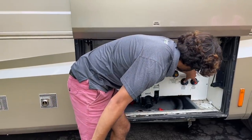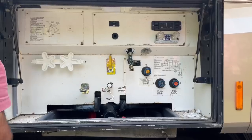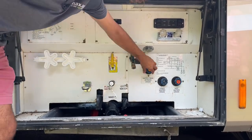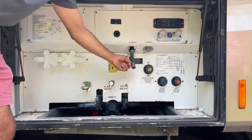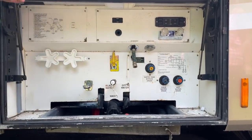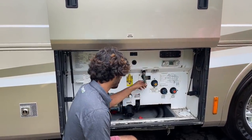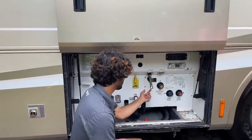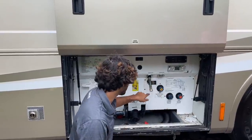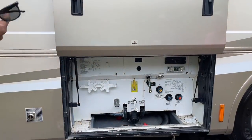These are drains for the plumbing systems — they'll drain system water out of your plumbing. If you plug in city pressure or a water hose and open that valve, it'll bypass the supply and let pressure go into your tank to fill your fresh water tank. So if you're plugged in at a camp spot and you're about to leave and want to fill your tank, just come out here, leave everything plugged in, and open the valve.